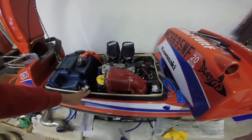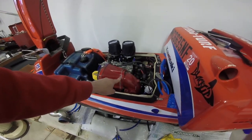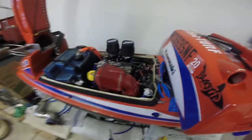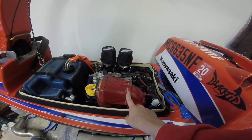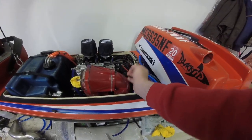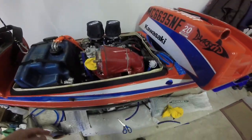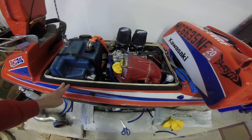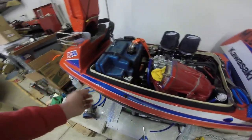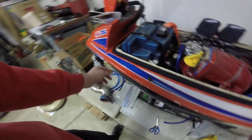Hopefully it all works out now. And I already made a short video about half pipe gaskets, so just make sure you get the correct gaskets that are specific to half pipes, because this gasket has holes in it, where the stock one is just solid, no holes. So that's important to have. And then, if you're having trouble with your half pipe, always check your gaskets first. If you have a first gen, check the hole here, check the hole in the expansion chamber.